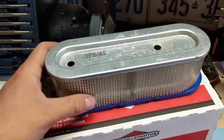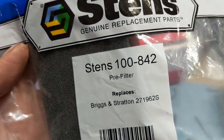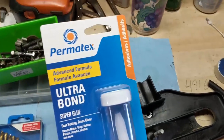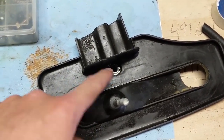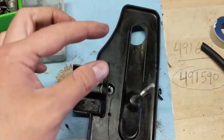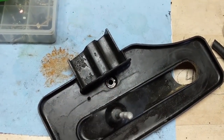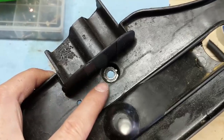I have a brand new OEM Briggs & Stratton air filter, part number 399806S, and a Stens pre-filter part number 100-842, replacing a Briggs & Stratton 271962S. To seal the old hole I'm using Permatex Ultra Bond super glue — I put tape on the underside of the hole, add super glue, then sprinkle baking soda on top. The baking soda triggers a chemical reaction that hardens the super glue almost instantaneously, and repeating the process essentially creates a hard plastic fill that will prevent air or dirt from passing through.